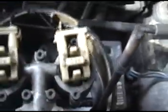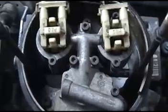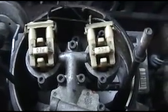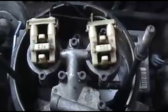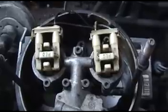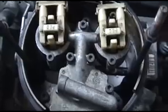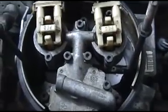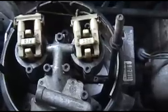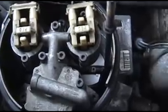You just want to look around and make sure. And when you look at your cylinder spray, just picture a badminton shuttlecock, the little thing you hit, which has that little triangle, dome shape. That's how your cylinder spray of fuel should look. That's what it reminds me of, a badminton. So make sure all that looks good and it's not just pissing fuel out.